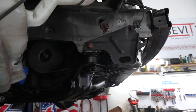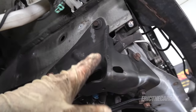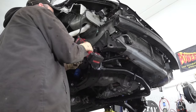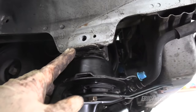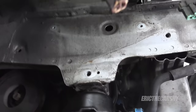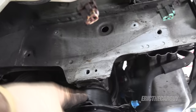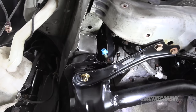That's not cool at all. I'm pretty sure you saw that I'm not happy, and I'm not happy because this bolt, despite the fact that I've cleaned the threads, still seems to be having an issue inside of here. Looks like there's a plate on this corner. I'm going to remove that and see if I can get a look at what's going on. It looks like in the back there's a sleeve that this bolt goes up into and it's stripped. I need to somehow get in here and put some kind of fastener that will actually hold on to. Otherwise this subframe is not going to be held secure, and that's just not acceptable.